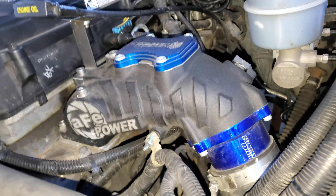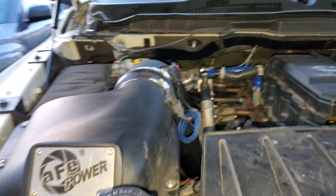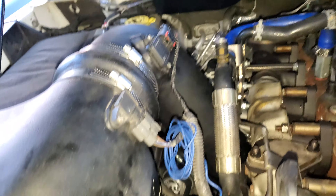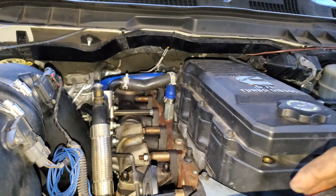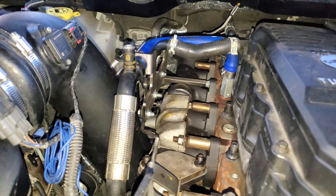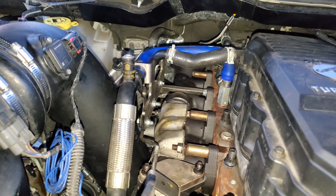So I found out what exactly happened, and the culprit is: if you have an AFE stage 2 intake, the breather coming in from the breather vent — there's a little rubber grommet on there — and I accidentally pushed it all the way through and it dropped down and chunked up my turbo. So it wasn't terrible, but it was enough.